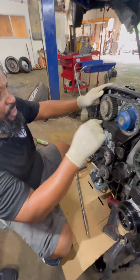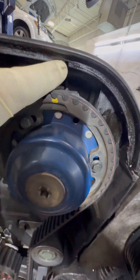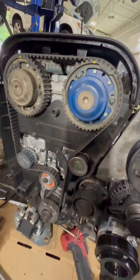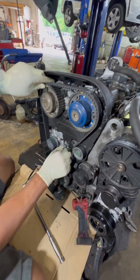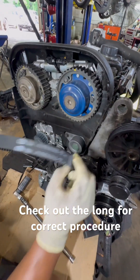So let's say we're doing the timing. First of all, you can see our timing marks. We've got a timing mark here in the window, and a timing mark here in the window. So for the purpose of this video, say we're replacing the timing belt. Let's get our timing belt off. We take tension off the belt and I'm going to slide the timing belt off.